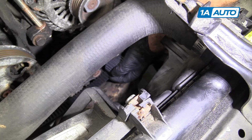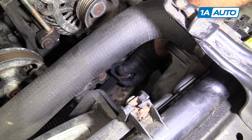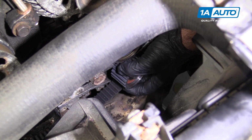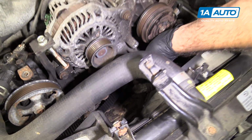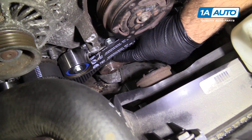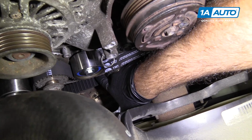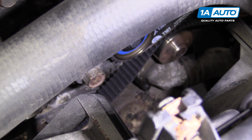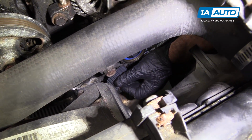All right, so if you're having trouble getting the timing belt over this little idler sprocket, a lot of the instructions for these do have you put the sprocket on first. You can loosen it, take it back off, and then we'll take the bolt with it in there. I'll get the timing belt set up in place over the water pump, and it's going to go down, and the mounting hole is right here for the sprocket. So we're going to kind of work the sprocket down in there and get the bolt caught.